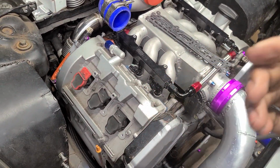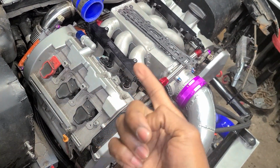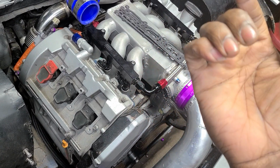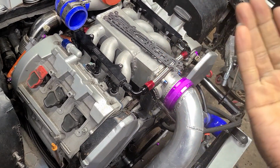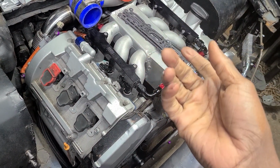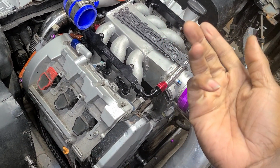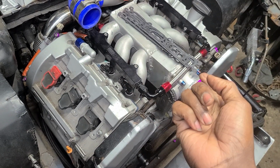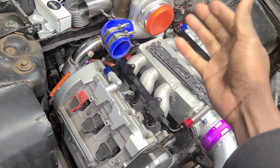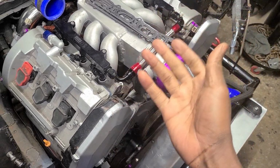Eventually I might get a breakout box to add more sensors, because when the 1.8 blew on me doing our mini autocross road course in Bader Field in Atlantic City, I was downshifting a lot to keep the car on boost. I was running the Eurodyne setup 630 file for the AEB 1.8T turbo, and I think starving G-forces while boosting caused my head to tap, and then the oil pump went because it wasn't changed, and a series of stuff happened. The timing belt eventually let go, and the timing chain tensioner guide in the back disintegrated, and that's the end. The head was screwed, the bottom was okay, but eventually I junked the whole block.